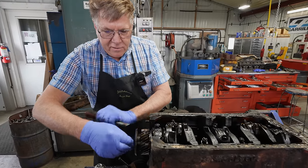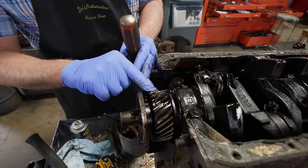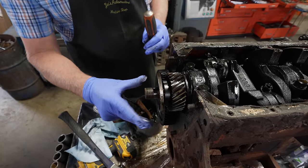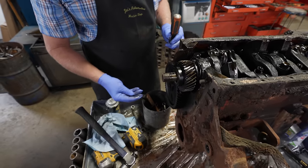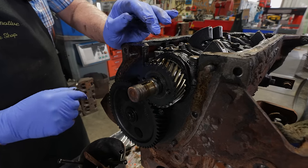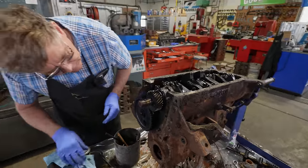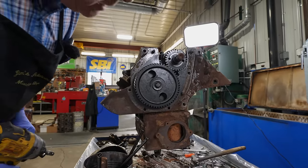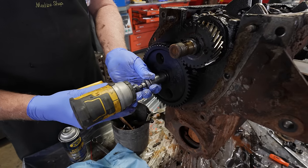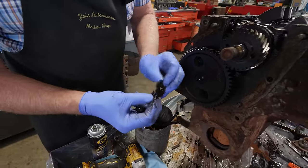Take the key out of the end of the crank — a little half-moon key. Then I can take the oil slinger off. This slinger, as the oil gets squirted out between the gear teeth when the engine is running, catches that oil and slings it back out to help lubricate everything better and keep it away from the front. There's a timing seal, a spacer that has to come off. This has two threaded holes in there — if we decide to pull that gear off the crank, we'll have to put a puller on there and actually pull that gear. Timing gear — looks like that's still a fiber gear. I'm not sure if they ever came out with metal replacements on these or not. I would say somebody over-torqued that star washer at some point — that shouldn't be all caved in as much as that is.